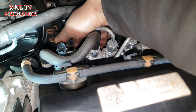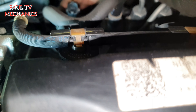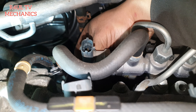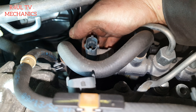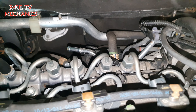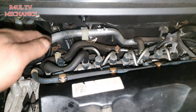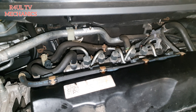We've got all four in. All we're gonna do now is get the plugs back on. I can't get the camera in there, but the glow plug is there — you just feel for the end and click the wiring plug back on, listen for the click. Same on all four. Everything's back on, all tightened up. We'll get the bracket back on, get all the wiring plugs back on, and start it up — fingers crossed.